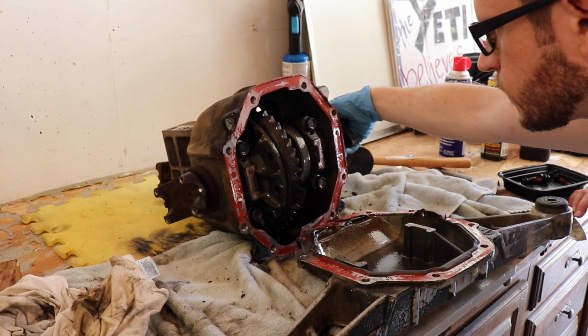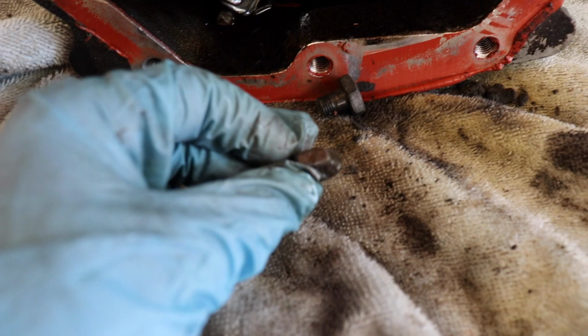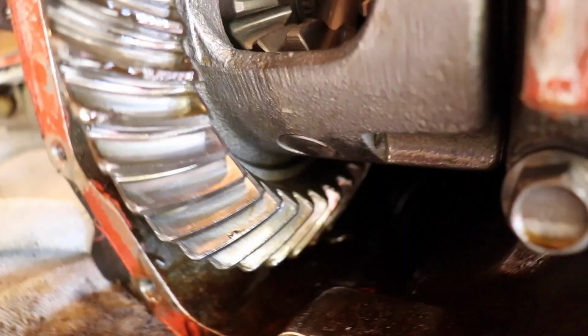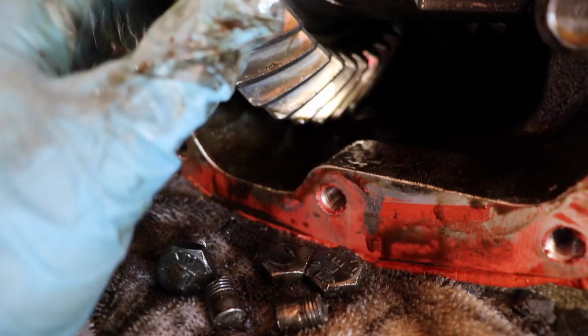All right, so what are all these pieces down there? Yes, sir, the heads of the bolts bust right off. Damn, man. Damn! All right, you guys, you are seeing firsthand what happened inside the Viper differential. You're seeing bolt heads, you're seeing bolt bodies. All the bolts on the ring gear got completely sheared off. There are definitely more back there, so we've got a couple heads here. Another head there, and then I see two or three more heads under the ring gear.